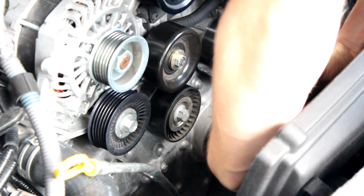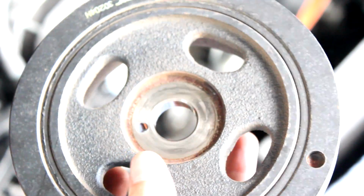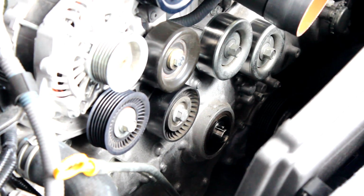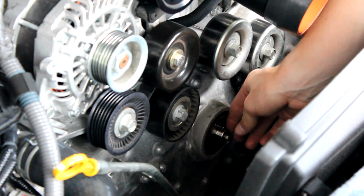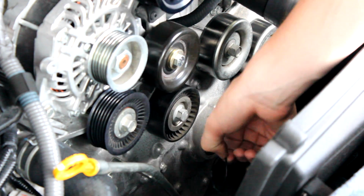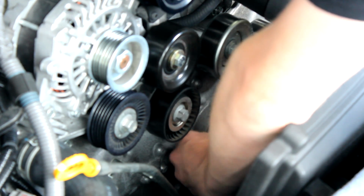Next, you take off the pulley itself. It's not on with any kind of pressure or heat treated on or seized on. You're just going to be able to pull it right off. What you will have to be careful about, however, is the O-ring that seals that on. Make sure that's in there properly. I had a lot of trouble with this O-ring right here. It takes a while to make sure it's on there properly. If it doesn't pop out, you can just leave it in, but otherwise I would definitely make sure that you get that on there perfectly right. It doesn't really want to go into the slot very well, and I really struggled in this part.